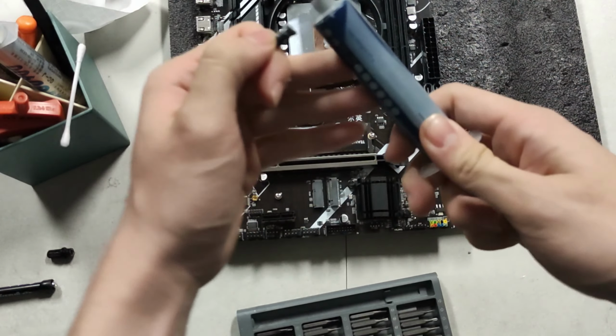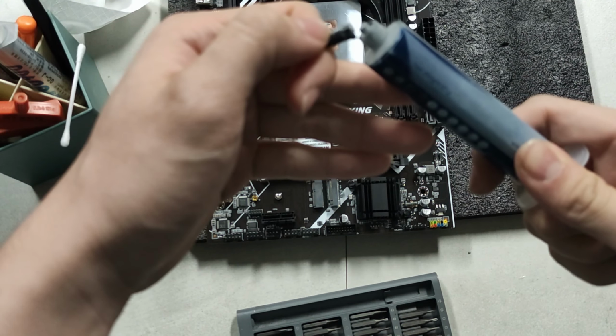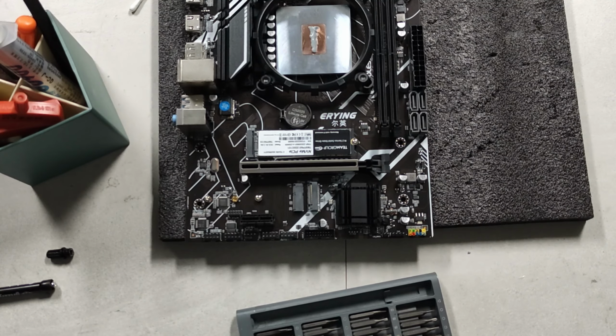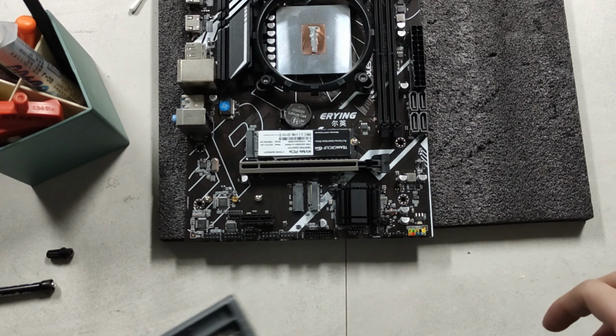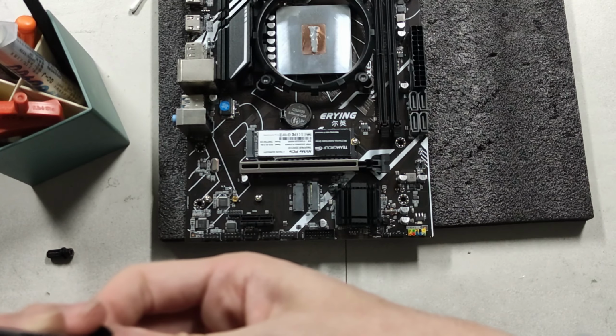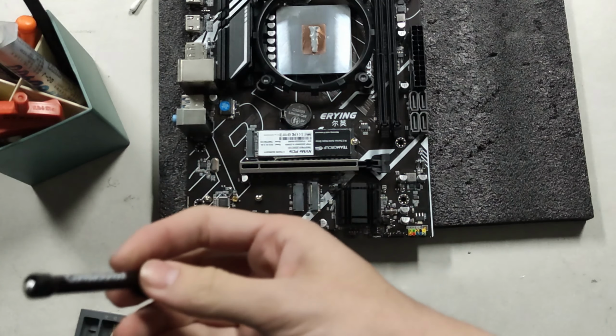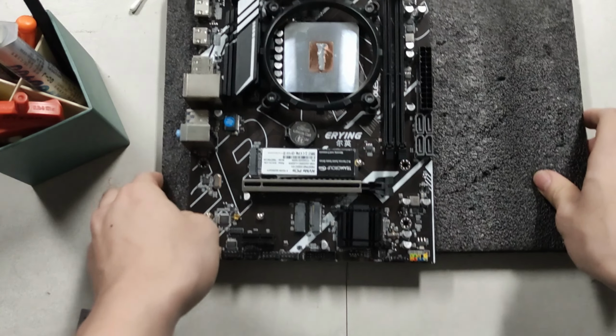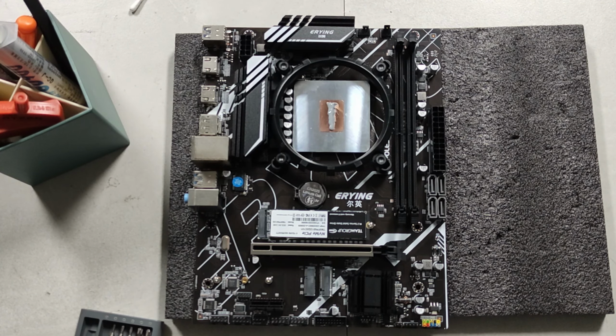Very simple. Thermal paste. We're gonna suck it back in the tube a bit, and we're gonna close it. Alright, now that's done, let's clean up our rubbish. Let's keep a tidy workspace, obviously. And we're gonna seal back our liquid metal. Do not do this over the motherboard, do this on the side, so you don't spill any liquid metal when you accidentally flick it.